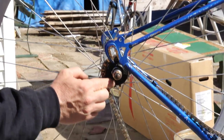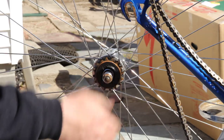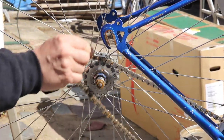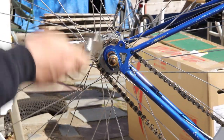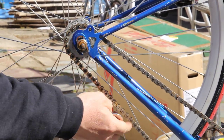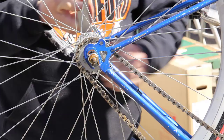So we want to flip it over from our freewheel side — which is what this side is. Some of us are running a BMX half-link Shadow Conspiracy chain on this bike. We have the freewheel side so he can coast, and then if he wanted to turn it around to the fixed side he would just flip it around like that — hence the name flip-flop hub. The teeth on his fixed side and freewheel side are the same, so relatively the chain tension we can monitor on each side. Don't just crank up on one side when you're flip-flopping it out.